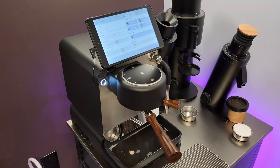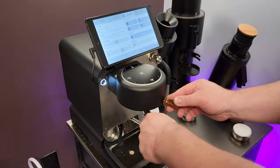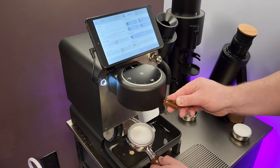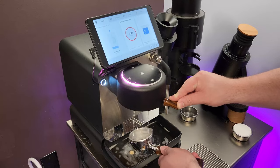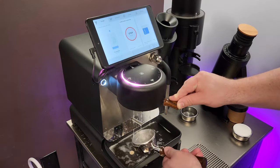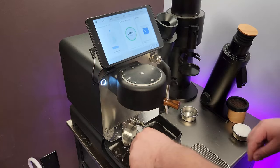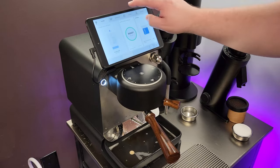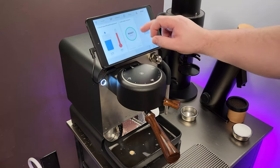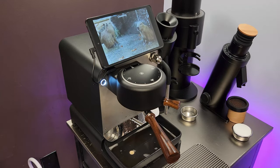That's the first cycle. I basically do a cycle with detergent, and then there's obviously detergent left — as you can see there's a bunch in the basket. So I dump all this and wash it, make sure I rinse the basket really well, let some extra water run through, then put the blind basket back in place and run the cleaning cycle once more to get rid of any residual Cafiza solution.